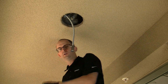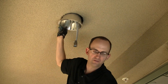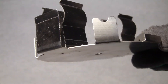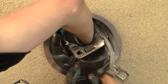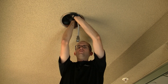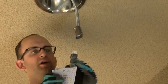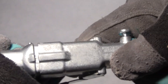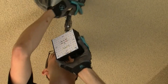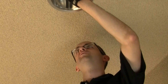What we'll do now is slide the quick connector through the trim and take the bracket assembly here — this is going to reconnect on the inside. The clip I've pushed through the center rod and I'm now going to reinstall the wing nut that will hold the whole assembly in place. Then we'll take the LED engine and connect it to the quick connector, which is designed so they only go in one way. Click and snap — it's connected — and then we'll push this back up into the inside of the reflector. Now we've got the LED engine in place and nice and secure inside the existing reflector.